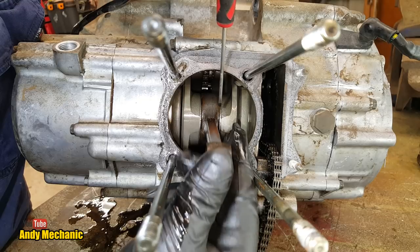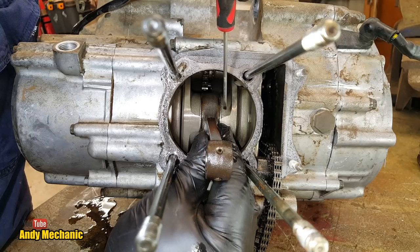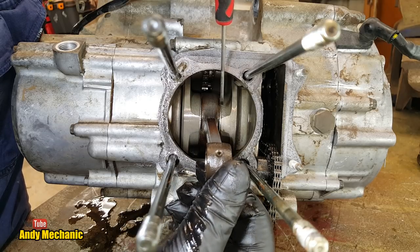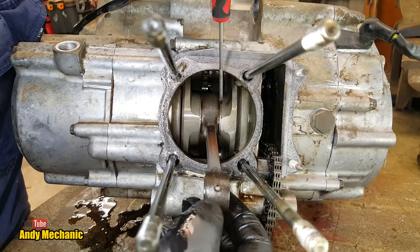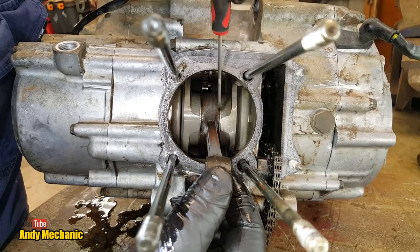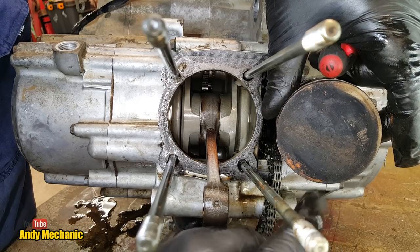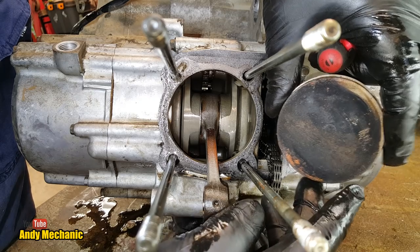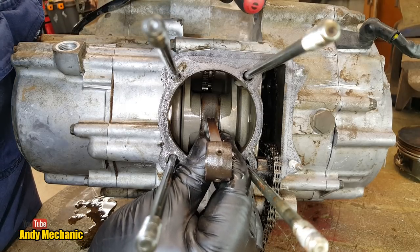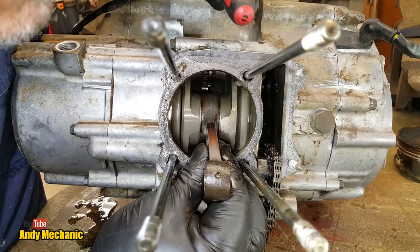The issue we're looking for is if you get hold of the conrod, and as you're looking at now, if I pull it towards the camera and push it away from the camera, I'm trying to feel any kind of movement. And there shouldn't be any. It should be solid. If you imagine this thing's whacking up and down that cylinder at, I don't know, 4, 5, 6,000 RPM, that piston's flying up to the top of the cylinder at a fair rate of knots, and it stops dead before it crashes into the cylinder head. And if there's play on here, then there's a chance that the piston crown, this part here, could actually make contact with the cylinder head, and that would be really, really bad. You'll hear a loud banging noise, and things wouldn't last very long. So you've got to check that there's no movement up and down on that bearing, and I cannot feel anything. Side to side, sure, no problem, but up and down, nothing.